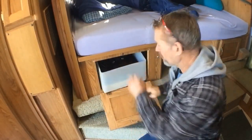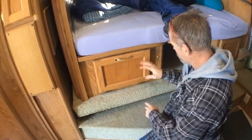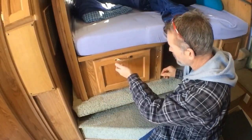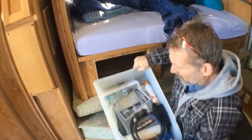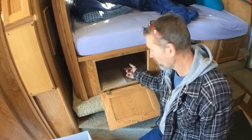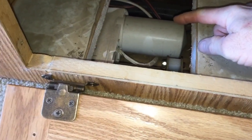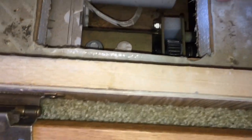There's another service point for the slide-out mechanism in this cabinet here. Some of your doors — if you've got the Fleetwood Elkhorn — your door might actually hang a little bit differently. Flip that down, take out your little tray, and there's an access panel here with four screws on it. Just remove those four screws and I'll show you the lubrication points there.